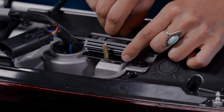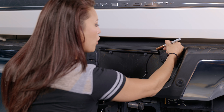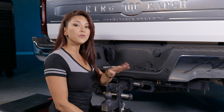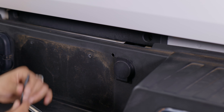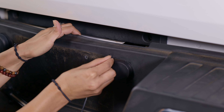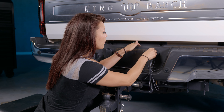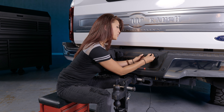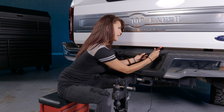For this install, go ahead and remove the two screws on your license plate — you can use a flathead or an 8mm socket to remove those. You'll notice there is a little wire on the back of your Boost Bar. Take a marker or something sharp to mark that spot so you know where to drill the hole. The reason we're drilling the hole is so we can take this wire and tuck it back behind the bumper so that the install is nice and clean. A trick I did as well: go ahead and screw in your OEM bolt holes so you can get the exact area where that wire is going to be and mark right behind it. Before drilling, keep in mind there is a metal plate back behind this — do not drill all the way through the metal, there's no need for that.